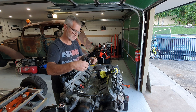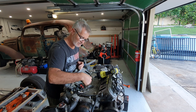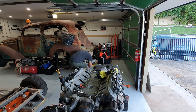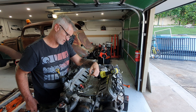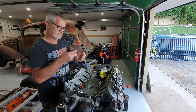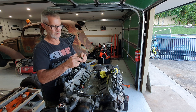As I showed you in a previous video, there's the plug and there's the rubber bung — the knock sensor is usually down that hole there. When you unscrew it, it's usually down that hole; it's a metric coarse thread, maybe 10mm. There's one at the front and one at the back. These two knock sensors are in and clicked on.